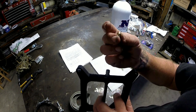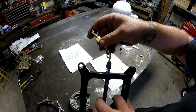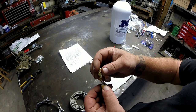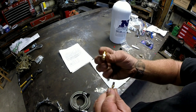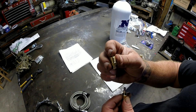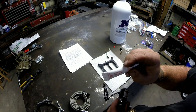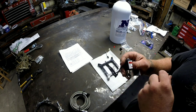To install them, you take the jet, your tube goes on like so, and you have to make sure you get it in the proper direction — then tighten that down. On the other end of your tube you'll have a compression fitting, which consists of your compression nut, your ferrule, and then your fitting. This is a 3/16-inch tube to a 1/8-inch NPT — national pipe thread — fitting, and this is what goes to your solenoid. This is our fuel solenoid; it'll thread into that and I'll put some thread sealant on it. You don't want to use thread tape because if you get a little piece of that in the solenoid it'll mess everything up and ruin your day.